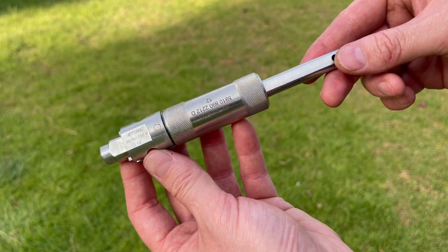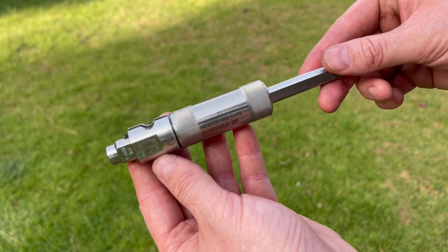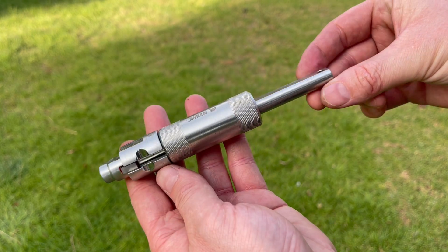Although manufacturers make a specialist tool to install the circlips, unless you plan on regularly rebuilding engines it's probably not worth the investment. So in today's video, although I will show you how to use that OEM tool to install circlips, I'll also show you the method of installing them with nothing other than just a pick — and even with this you can do it safely, effectively, without damaging the clip, the piston, or your hand, or having them flying across the room.